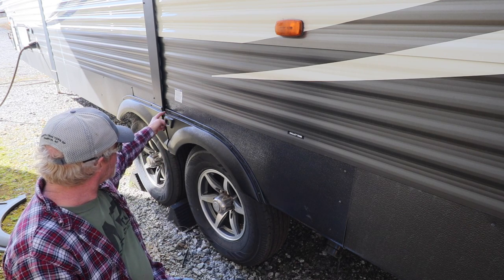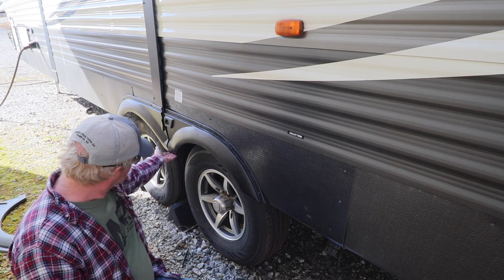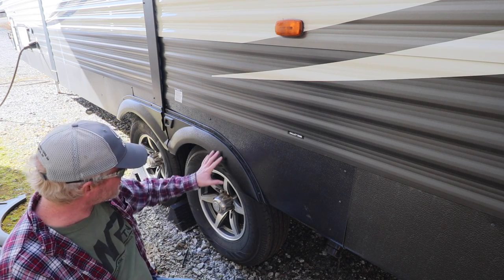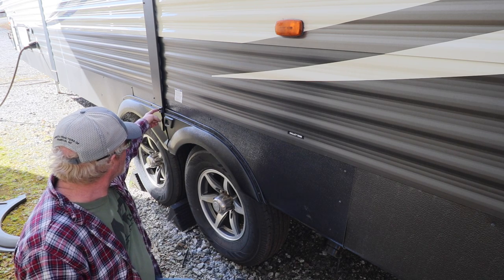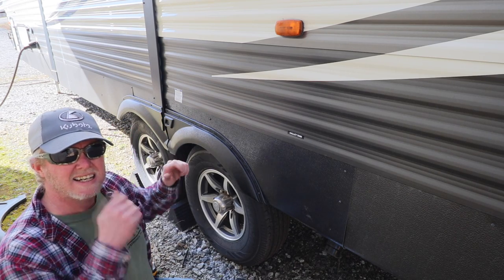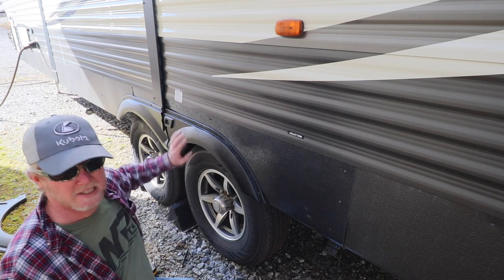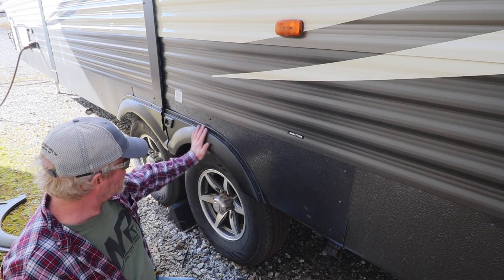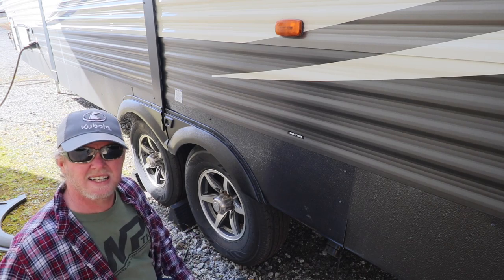The only other thing I had to do was make a little aluminum brace to come out and push this ahead. This was kind of trying to tilt up underneath. It didn't do as bad here, but I got that done. The only thing I'll mention, I haven't put one in and I don't know that I'll replace it, but they had a cutoff screw here. I'm assuming they pushed the slide out a little ways and trimmed the screw off, so that when the slide goes back, the screw doesn't hit this piece. But I've avoided that completely and put this over here, out of the way of everything. Overall, real happy with it. It looks as good as it did when I bought it, and I got this side replaced.